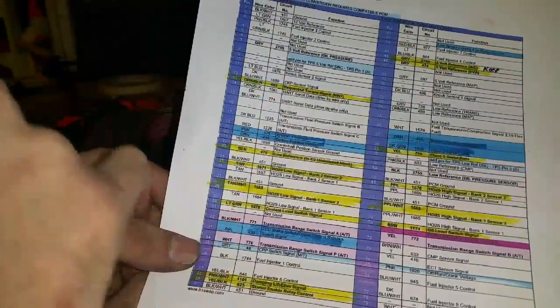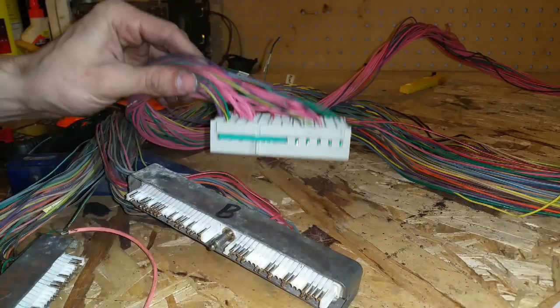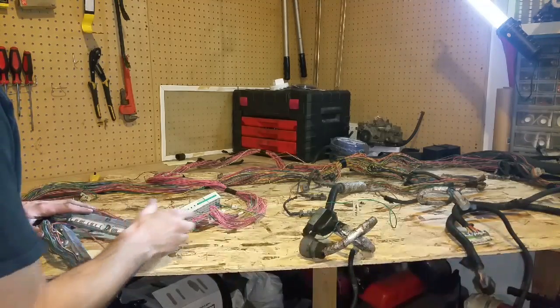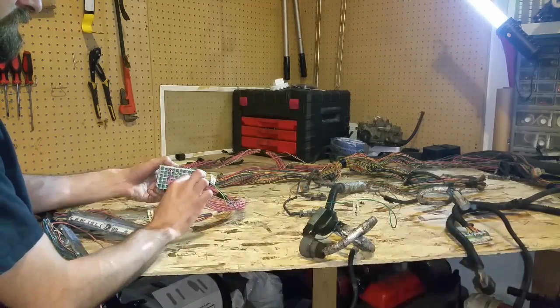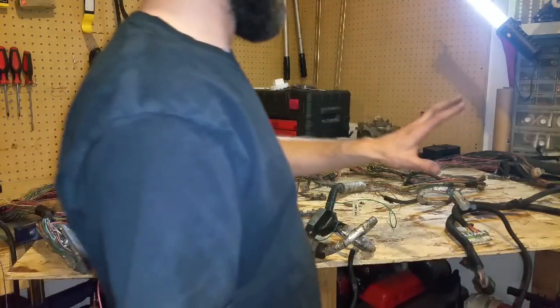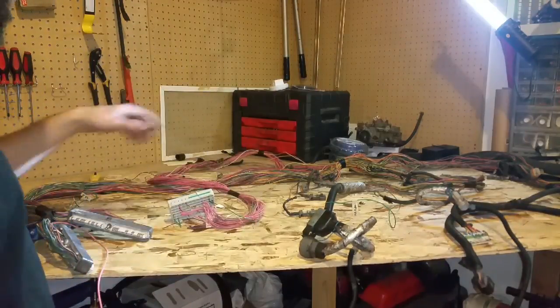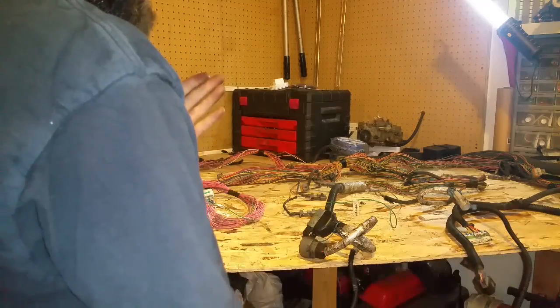Now I'm just going to go through the rest of the diagram again. The ones marked in blue are going to go to external sources from the PCM, so I'm just going to keep going through, verify at the ECU plug, and verify here as I cut them off and label them. The ECU side is pretty much complete. I still need to go through the pink wires and some of the other plugs on the other end of the harness. This is all the wire I've taken out already and I'm not done yet — definitely lightened it up quite a bit. Thanks for watching — leave a comment and watch for part two.